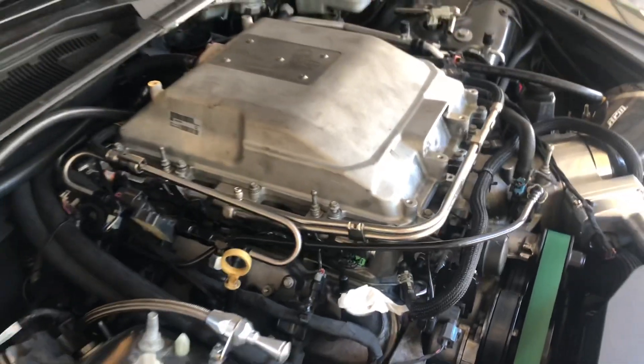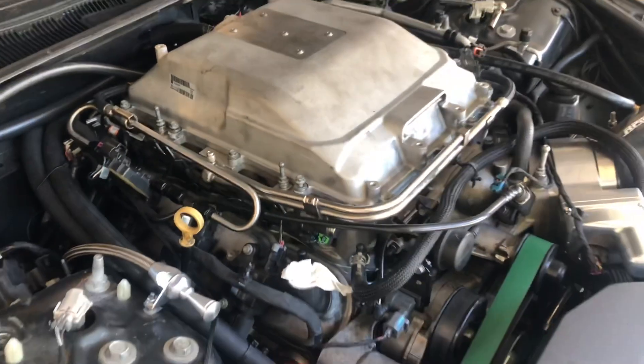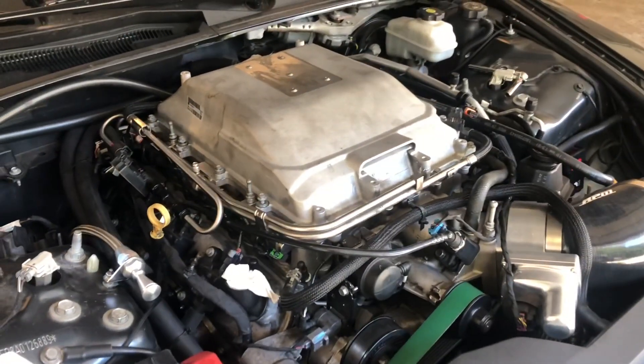Still pretty easy overall. I'm putting the bolts back into the blower lid and the fuel rails and I've got to load my new tune in and then we're going to start it up. Injectors are in, got everything wrapped up and went over everything — but when I got in the car to load the tune it said failed pretty much immediately. I went back through and found out I forgot to finish completely clipping in the two front injectors. Definitely always double check — it's cheap insurance.